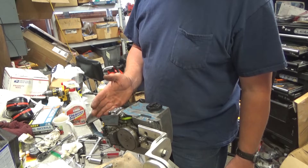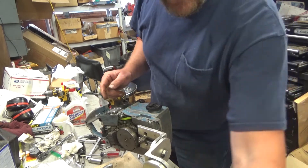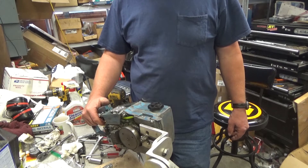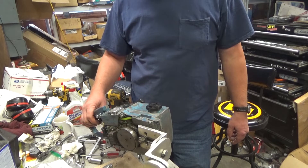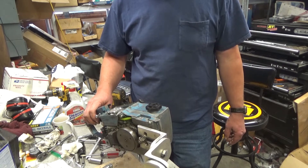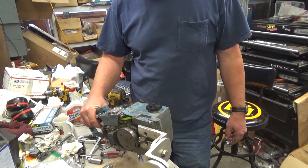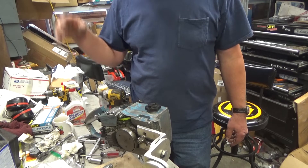She's been idling for the better part of 30 minutes. I've got it running rich right now simply because I wanted to make sure it got plenty of lube on break-in, and I had a lot of oil in there lubing everything up as I put it together — so flush all that out. It's running pretty clean right now, still a little rich on the low side, and I'm going to leave it that way. When John gets this back, you'll have to tune it a little bit for your elevation, especially once an air filter's on it.